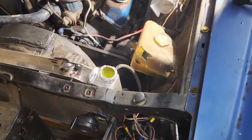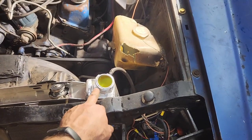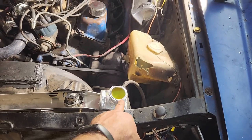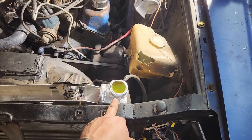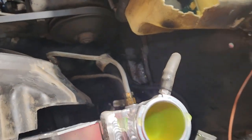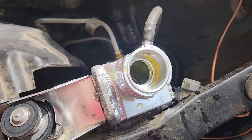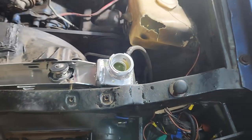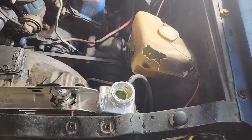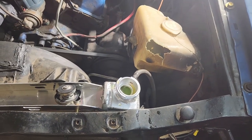I'm currently burping the baby. I know a lot of old school people do this. I'm basically running it nice and hot, trying to make all the air bubbles come out. As you can see, it keeps flowing over — that's the air pushing it back up. You'll usually get a lot of air bubbles in here as well. I can press it, get some suction, let it go, and start watching to see if it starts burping back up. Just trying to get the air out.